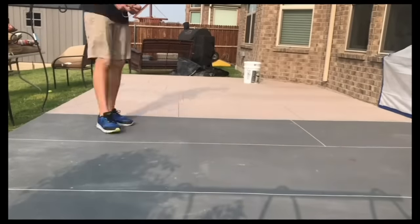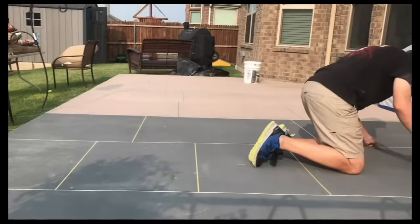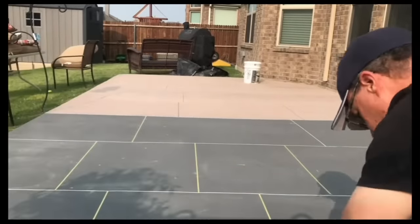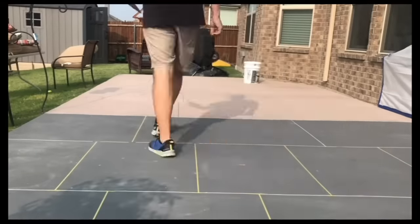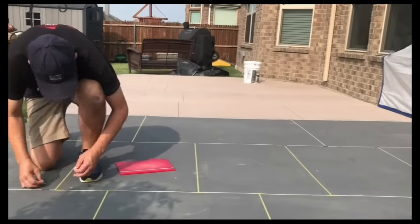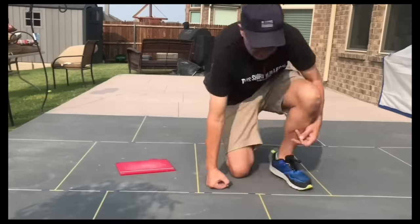After two more long rolls, I basically ran out of the good tape and switched to the automotive yellow tape. As I suspected, it wasn't nearly as good — it started pulling up on the ends. My solution was to double up on it, especially at the intersections, figuring the yellow tape would stick better to yellow tape. But that still didn't work that well. So I got some blue masking tape — it wasn't quarter inch, but I used a cutting board and a ruler to cut it into quarter inch strips, and that worked really well. That pushed down on everything and locked it in place. I also used that method to re-tape the grout lines from what I had already done, because I was going to re-spray everything with even texture across.